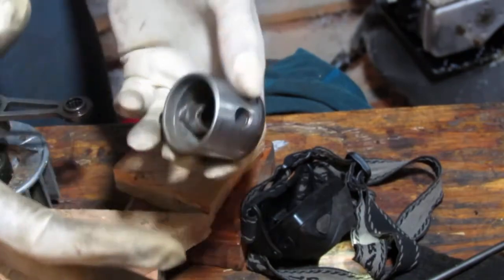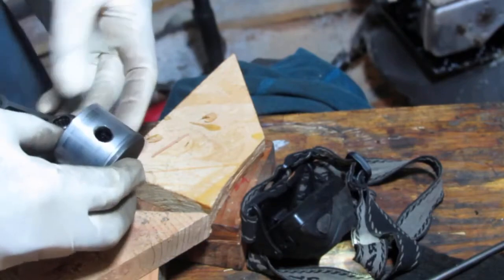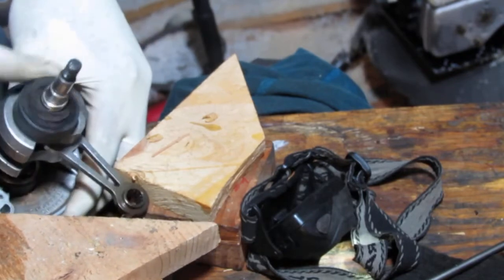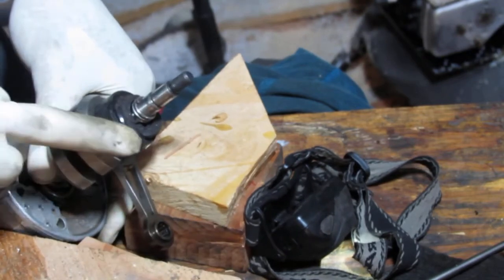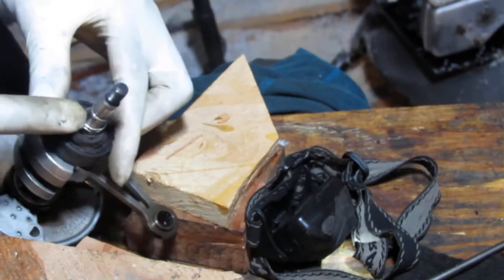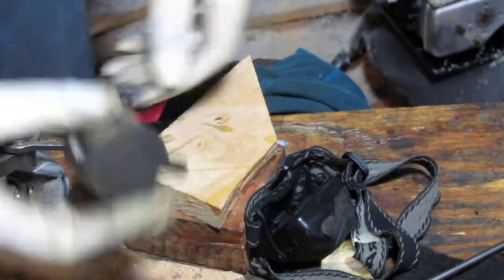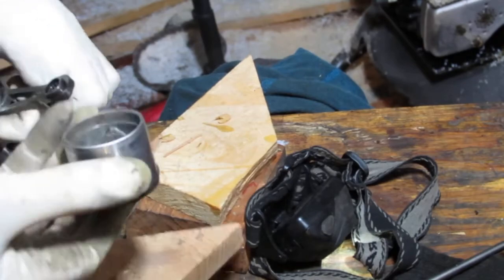All right, that thing is ridiculous. Now, at this point I could have just left this attached to that and called it quits, but I wanted to pull it out and clean it. I'm going to need a new oil seal. The bearing is fine for this, but you can see the seal is all destroyed here. So, all right, well, that's that. I'm going to leave that like that so I can just tap it back in with ease. This sat like this, so that way I know.